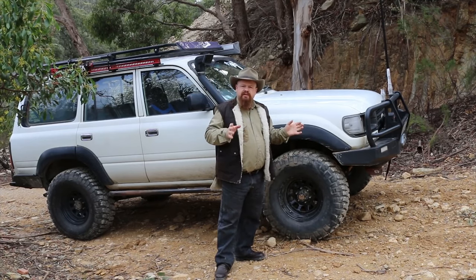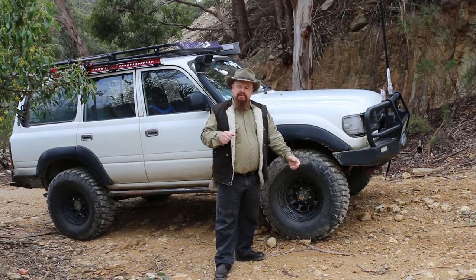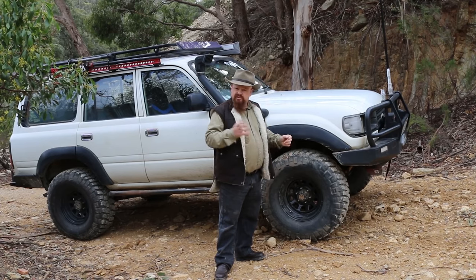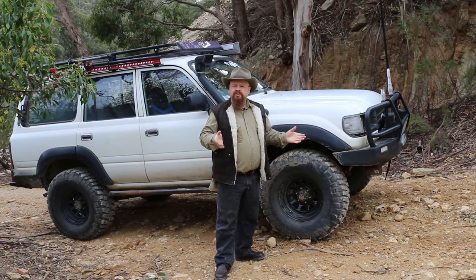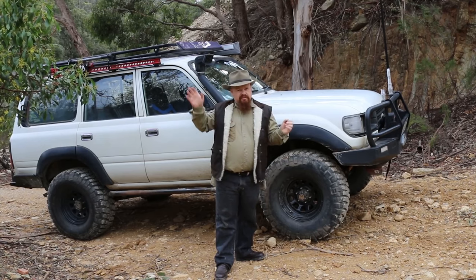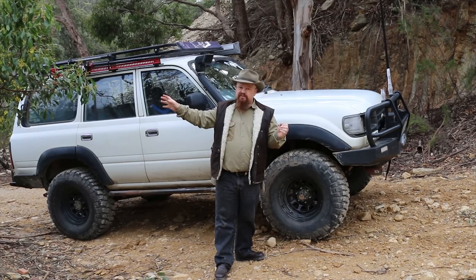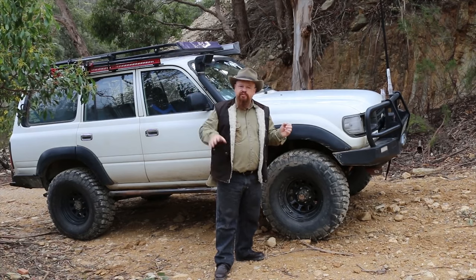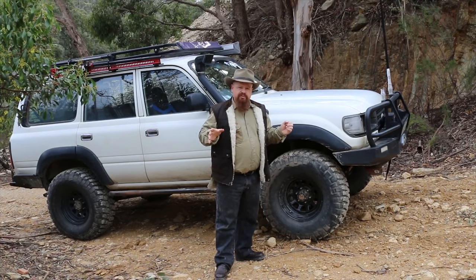We're in reverse and we need to get back down the hill. Slowly disengage the park brake, and then even more cautiously - so we don't induce a slide - take your foot off the foot brake. Now we'll be resting on the compression of the engine. Check behind, because guarantee when I get stuck there's kids or even young adults behind me taking photographs and posting on Facebook before I'm even down the bottom of the hill. Make sure you're checking clear behind - it's very important.